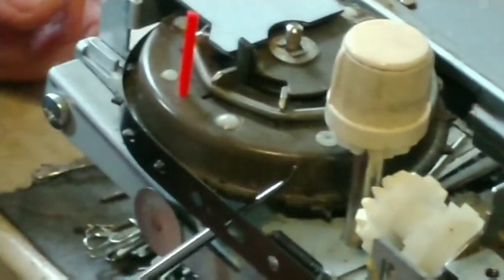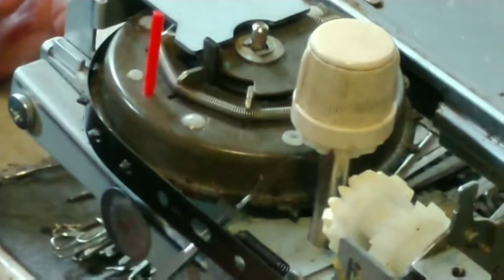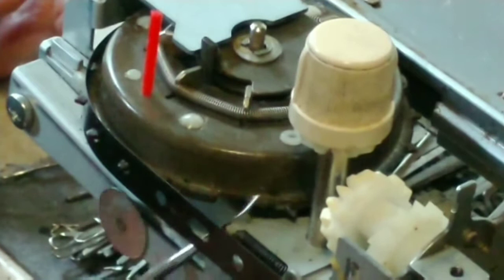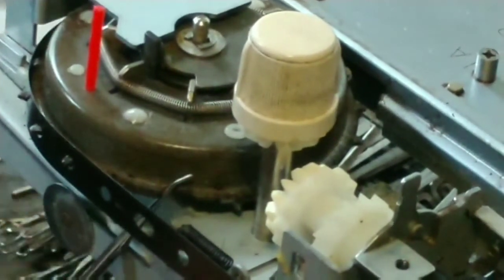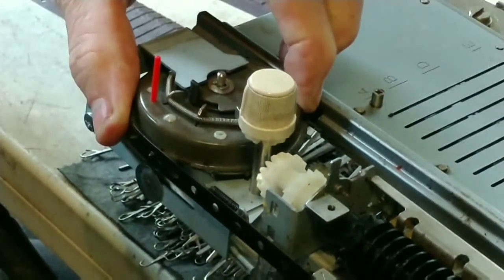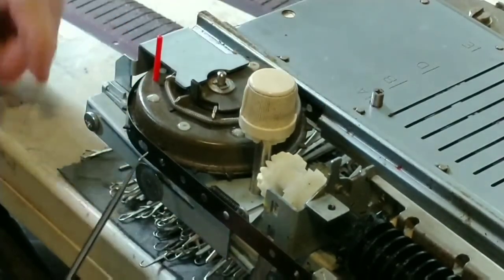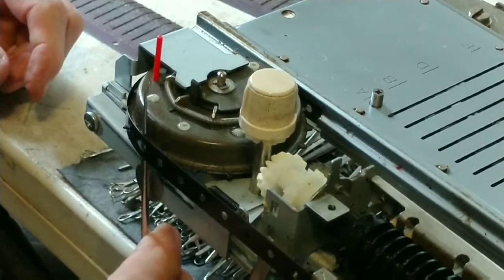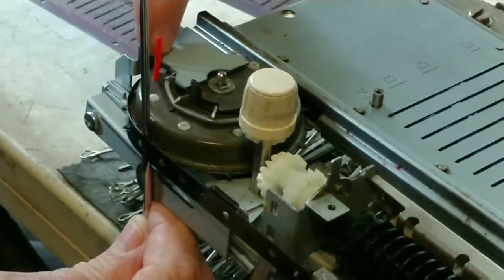Watch — I'm going to stick my indicator in here. Look at the outside edge of that drive cog. Can you see that I'm in a little cutout? There's a notch — yes. It's a flat rim with tooth, tooth, tooth, and then there's a notch. We're going to move in the same clockwise position. If you were looking down from the front of the machine, what happens is this oblong hole matches up to the notch — the first notch in the cog after the timing mark.